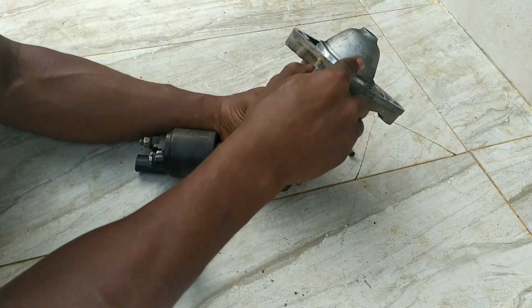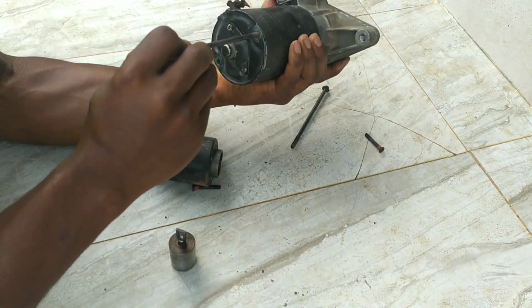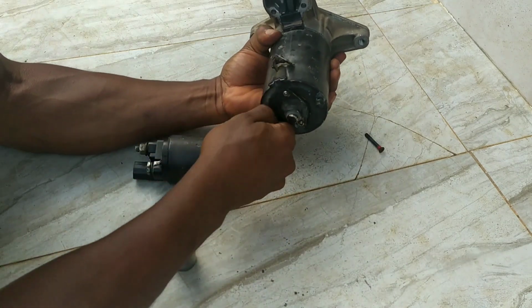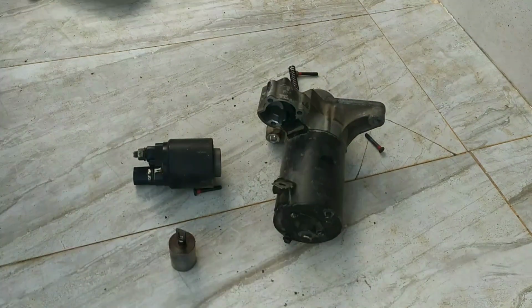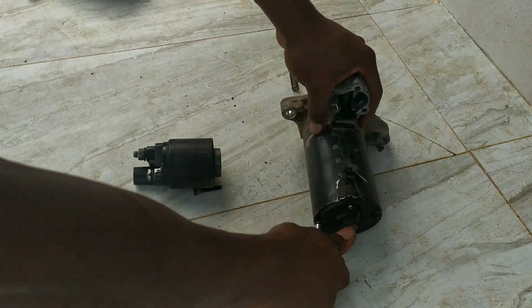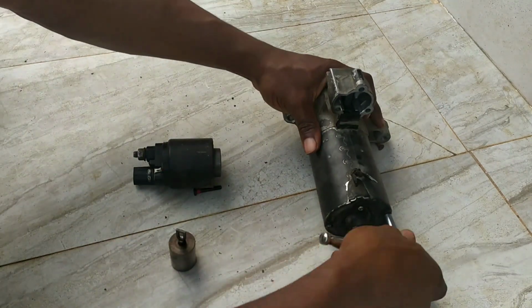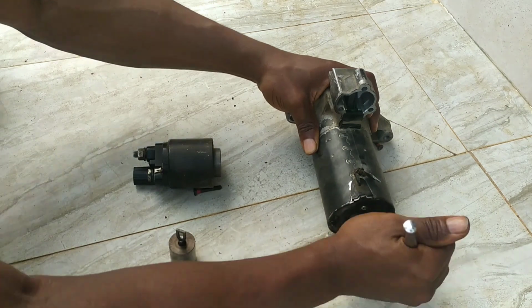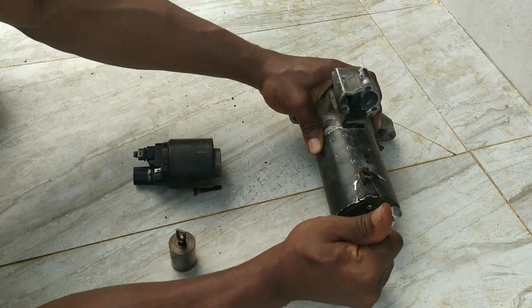Initially, I put on the casing there, bolted everything back up, and then realized that the solenoid plunger was proving difficult to put on. So after tightening everything, just make sure they're snug. You don't want to go too tight because you don't want to strip any threads on there. Here I'm using a 1/4-inch ratchet and holding onto the base, not the tip, so that I don't apply too much torque. Tightened everything back up.